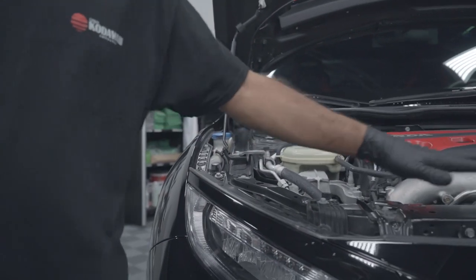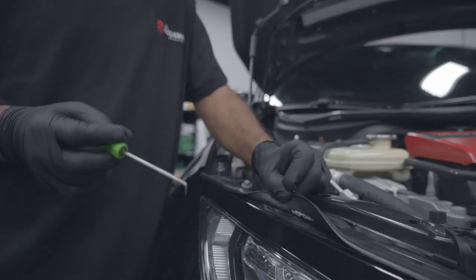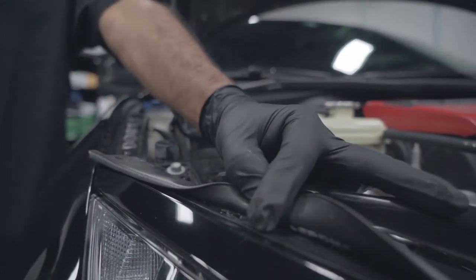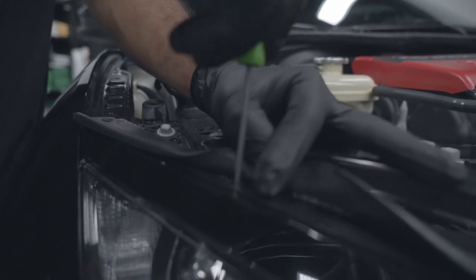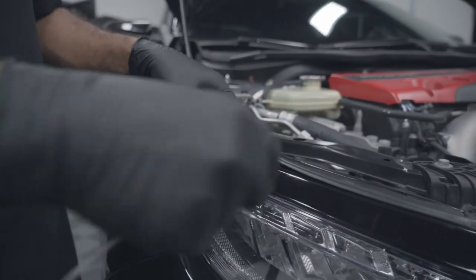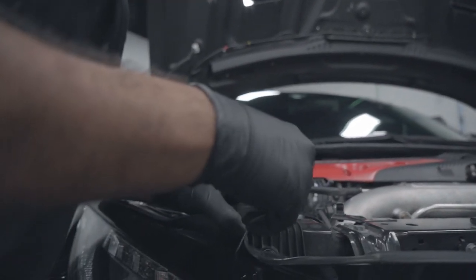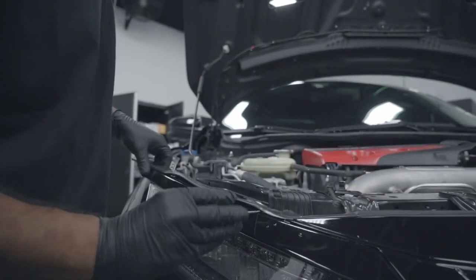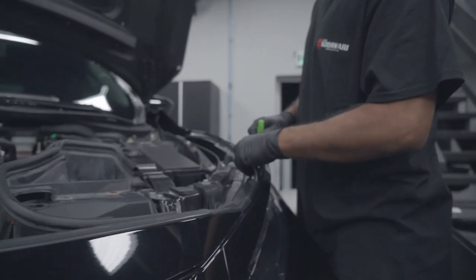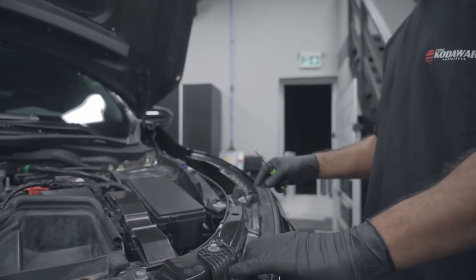To take the front bumper off, you've seen that top shroud removed. You're going to move the rubber just slightly away from the molding, and then just down below you want to take a look — push down and pull out. Now you have one part of the molding out. We'll go a little further up, same deal, just push down. And now we have the entire grill ready to go. Repeat the same on the other side and now you can see the whole grill moving freely.